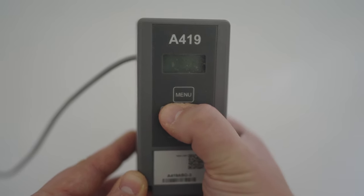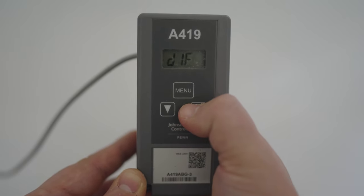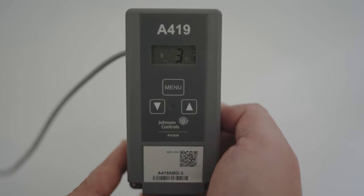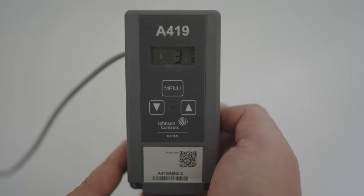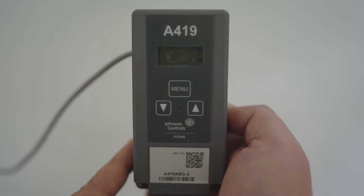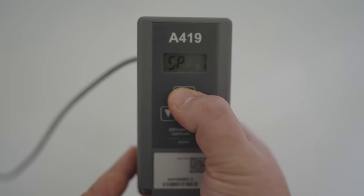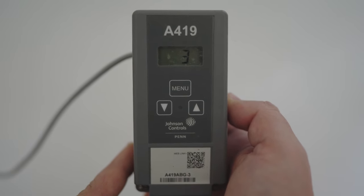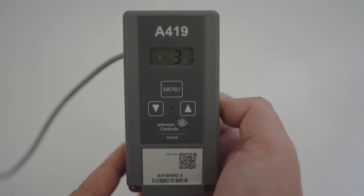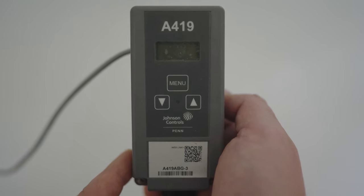To change the setpoint, use the arrow keys until your desired fermentation temperature is reached, then simply hit the menu button to return back to the main screen, and your setpoint is set. Next, we're going to talk about differential, or DIF. You can see that my differential is set to 3 degrees Fahrenheit. The differential will allow you to set an acceptable range between when the controller allows the freezer to run the compressor. For my setup, with a setpoint of 65 degrees Fahrenheit and a differential of 3 degrees Fahrenheit, the temperature controller is going to run the compressor once the temperature probe reads 68 degrees Fahrenheit, which is 3 degrees higher than my setpoint. The controller will then shut off the compressor once the temperature probe reads my setpoint of 65 degrees Fahrenheit. A narrow differential would cause the compressor to run more often, which will greatly shorten the lifespan of your fermentation chamber, so I like to give my freezer a little buffer to prevent the compressor from cycling too often.